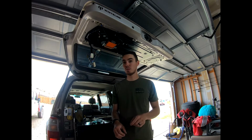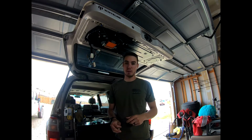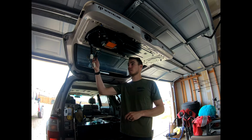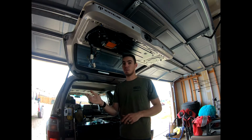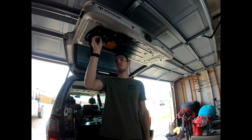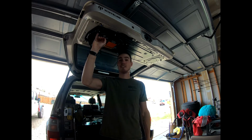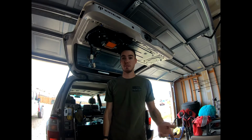I know it's super efficient and it's not using a lot of power, but one thing I didn't want was to be running off that anymore. I just coiled it up and I pulled the fuse out in the event that I come back in here one day and I want to run on that battery something else that's up here. So you won't have that. If you want to find an easier way, that's it. Blue wire is your positive 12 volts all the time.